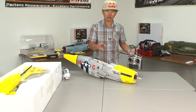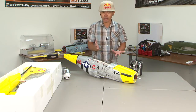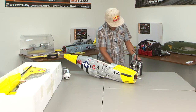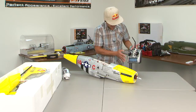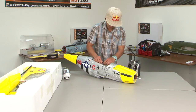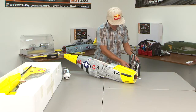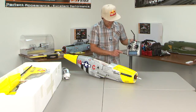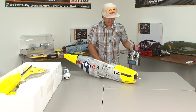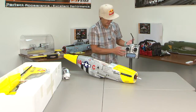Once you plug in the battery, give it about a second and you'll hear two initializing tones — it'll beep twice. As soon as you hear that, drop the throttle stick to the lowest position and let it sit there. You'll hear two more initializing tones and then a tone confirming it is programmed and ready for use. Let's try this now — transmitter on, throttle stick at the highest position. Those are the tones; I just dropped it to low. Those two beeps confirm the speed control read the endpoint positioning.